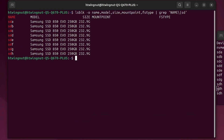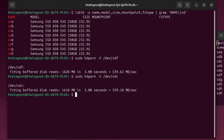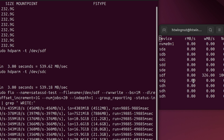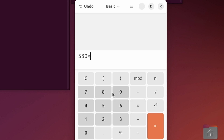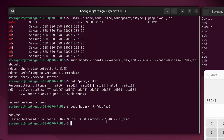To get a baseline for the SSDs, I ran hdparm and FIO tests. The hdparm read test on a single SSD showed about 539 MB/s, and a FIO 20GB write test averaged about 339 MB/s. I then created two four-disk RAID 0 arrays — one per connector — and peaked at about 1,929 MB/s on each, realistically about 530 MB/s per disk times four. An eight-disk RAID 0 across both connectors yielded about 1,940 MB/s — roughly the same as the four-disk array — suggesting the SATA controller may be limited to a single PCIe 4.0x1 lane.